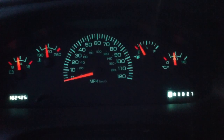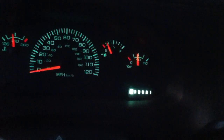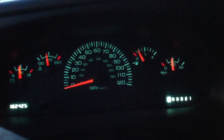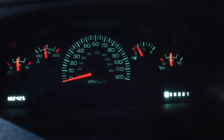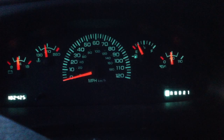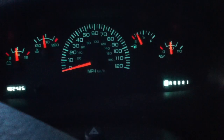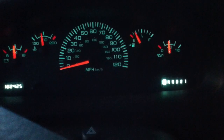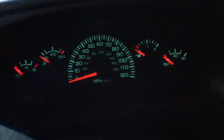Just a little follow-up here. I used one of these little Mighty Vac power bleeders on this thing. I wanted to pre-do it so I didn't have to pay the guy as much hourly to come out and do the bleeding. And I thought, well, I'll get it set and have him finish it up. But the thing is, I'd had my brake system flushed earlier in the year. And here, all my warning lights went out. The brakes work great. Really stiff brakes. Everything's 100%. And all I bled was the one wheel cylinder.